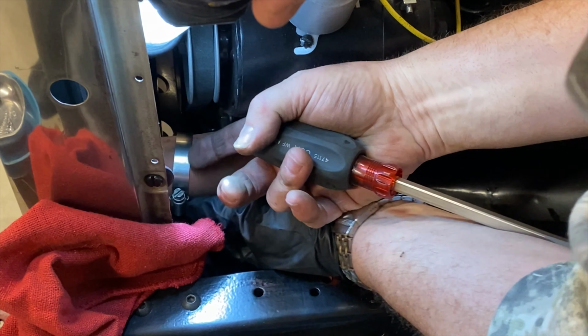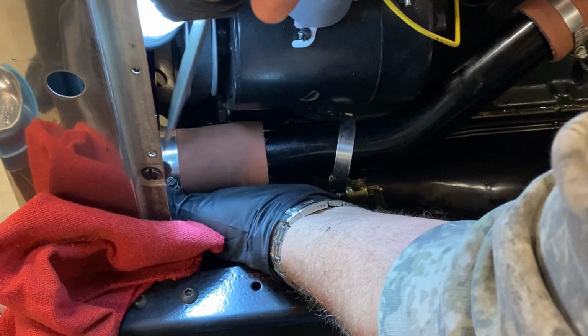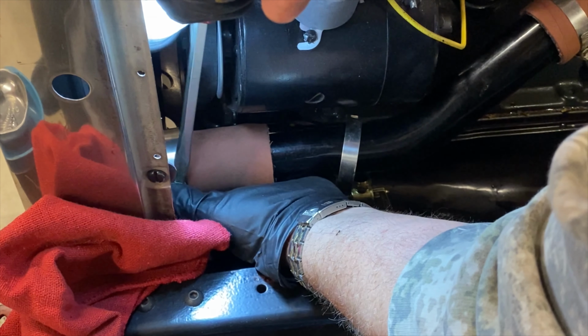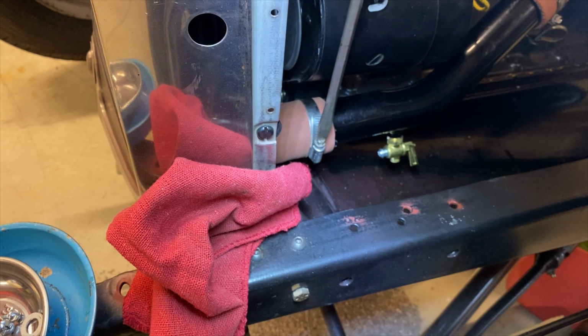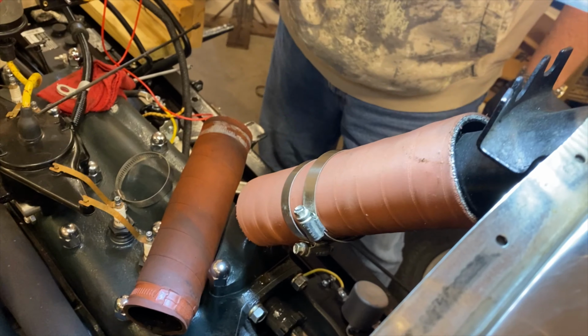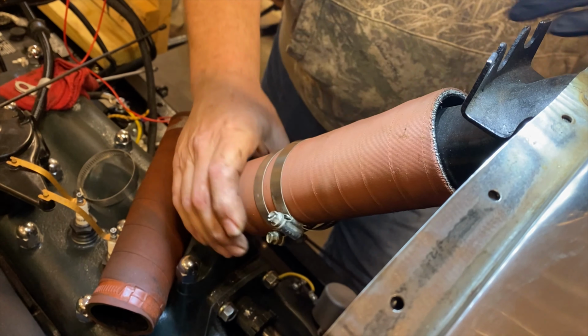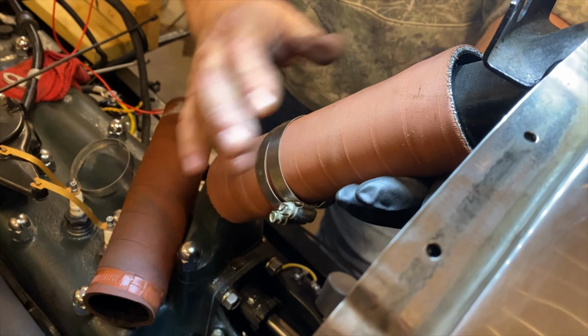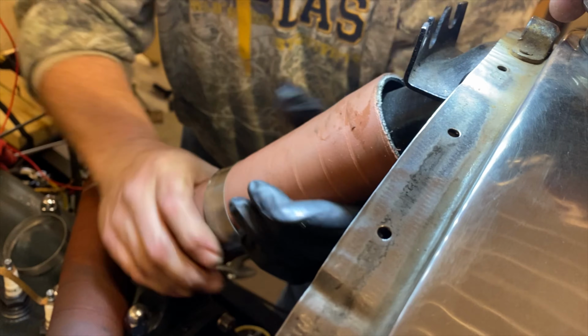Once the water pipe was ready, we attached our new radiator hoses. These hoses are supposed to be among the best hoses you can buy for the Model A. They aren't the original black radiator hoses with the red rubber tracer running through them, but they are red in color, like Ford used. We didn't get too fussy with the hose clamps themselves, and just went with some more modern clamps that we already had in the shop.